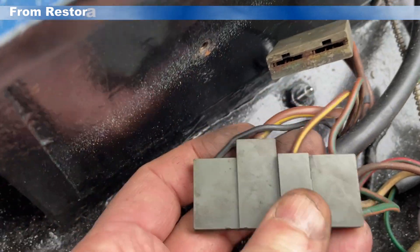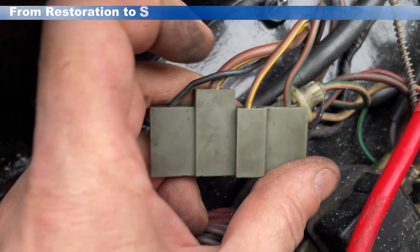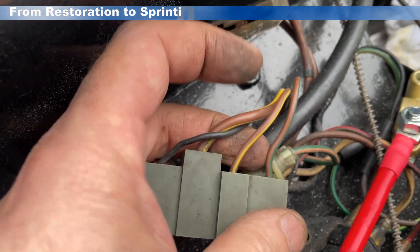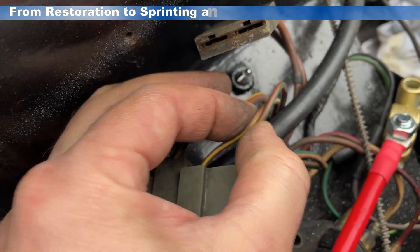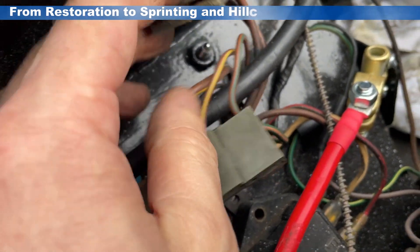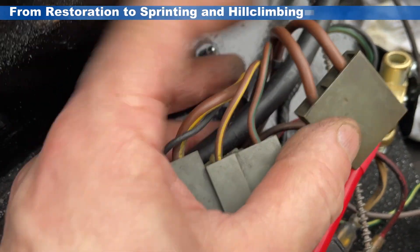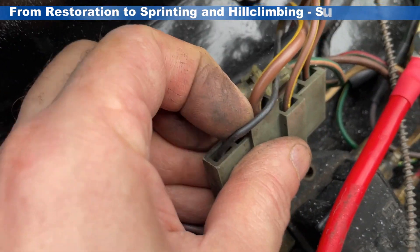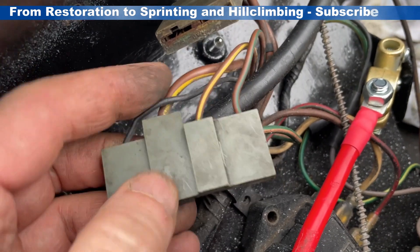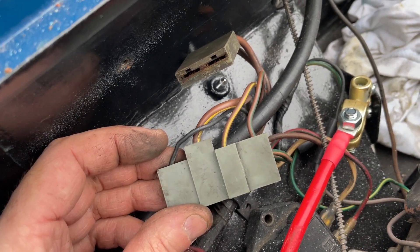After digesting the instructions, it's actually a bit more simpler than I thought. This is the feed cable on the voltage regulator from the alternator — it's the little wire — and that has to be connected to the little wire here that goes into the car dashboard and the ignition light. So these two wires here I've got to cut and connect together. All the big wires — this big yellow and brown one here and these two brown ones here — those have got to be cut and all joined together as well. This last little black one is an earth and can be cut and left capped off, as that was to earth the voltage regulator and is not needed. Little wires connect together, three big wires connect together, and in principle that should be good to go.